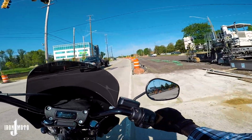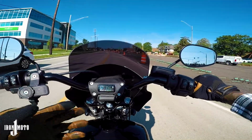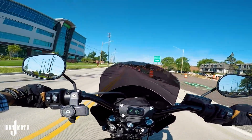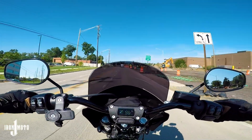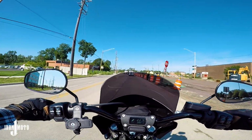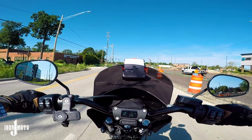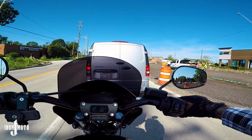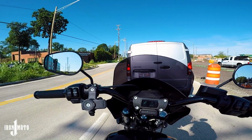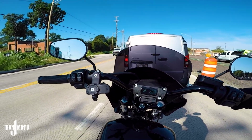A 12-inch rise is the most. Most T-bars or MX style handlebars come a little bit more narrow, so it really makes riding, in my opinion, more comfortable. It's not like some wide ape hangers, and again, anything I'm talking about, I don't hate on. I think ape hangers are dope. On a cholo style bike, ape hangers look raw as hell to me. On bobbers, they look dope to me.